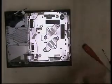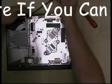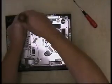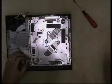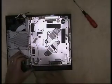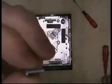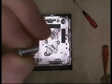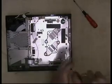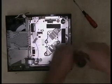Like that. Right, let's get these screws undone. Take the earth screw out first, which is there in the corner. And then what we're going to do is go along the metal plate, removing all these screws. They've all got little arrows on them until we've freed up the board. And these screws are small plastic self-tapping screws. There's one in either corner, and they go up the side.